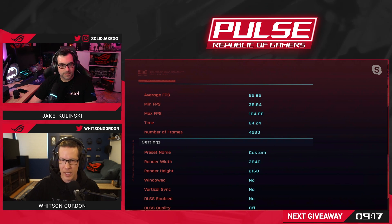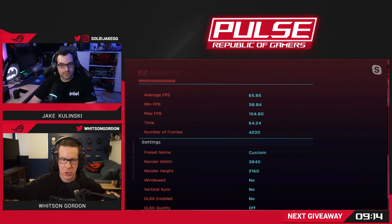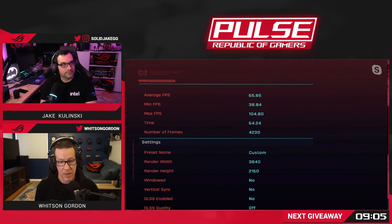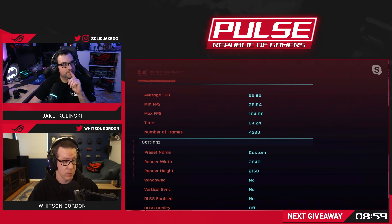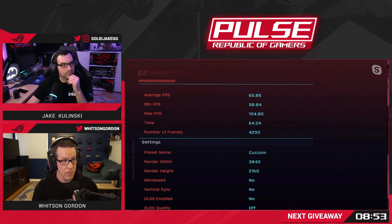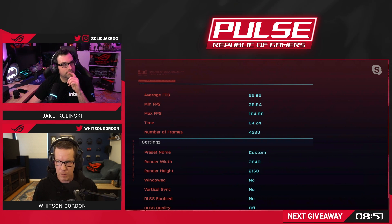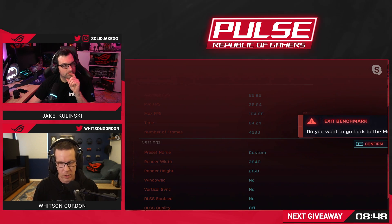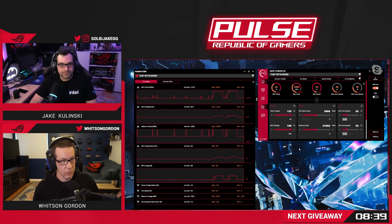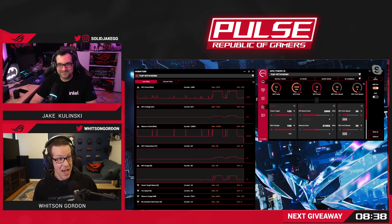That's pretty cool. And if you're playing at something like 8K where there's just no CPU involvement at all, you might see the max FPS go up too. It's going to vary from game to game and vary a lot depending on the resolution you're playing at and whether you're playing with ray tracing. When I tested Cyberpunk with this same benchmark with ray tracing on, the boost was a little bit smaller — more like a 9% boost in minimums, because of the way power usage interacts with the RT cores and tensor cores. A 12% boost in minimums for literally five seconds of work is not bad — I will take that.